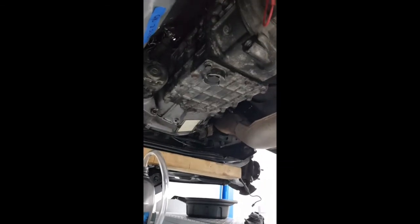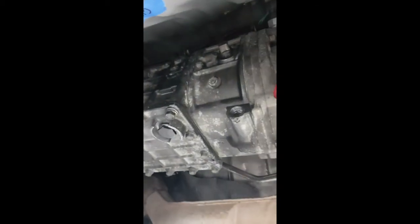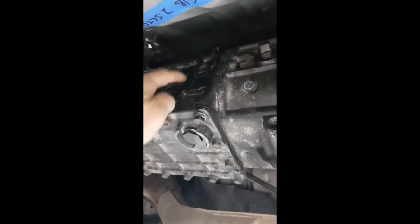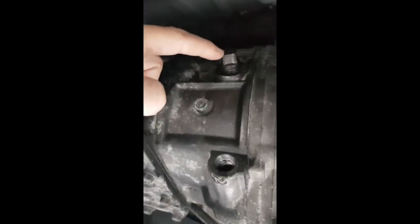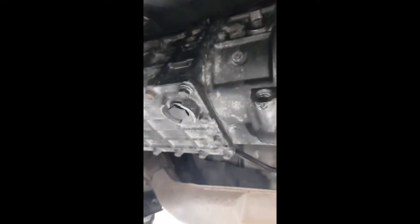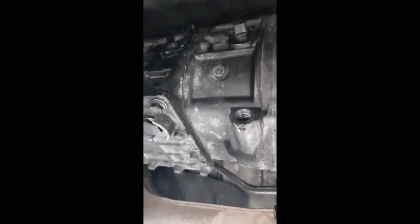Right, okay, so I've moved down to the gearbox. You'll see underneath, there's actually 4 plugs in the gearbox, which can be confusing. So you've got the main drain, which I took out and drained everything down. You've got an Allen key plug here, which is a T55 Torx fitting. It's not really got a use. This is the fill, and this is the secondary drain, which is actually definitely worth opening. Well, you have to open it really, but I think I got about 200 mils extra out of that.